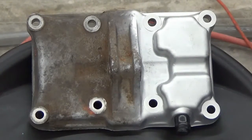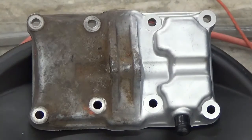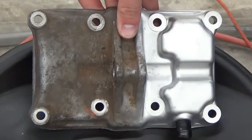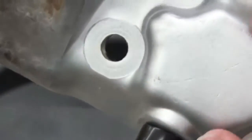We have just vapor honed this top cover for the CB350. What we wanted to show you was the original looking condition versus the vapor honed condition. While vapor honing, we wanted to show you how it does not damage rubber or plastic pieces. This is a rubber boot, rubber bushing, and as you can tell, it is unscathed. There is no damage whatsoever. You can even see the surface — how clean and smooth this part is — and this was left on here while we were vapor honing the cover.